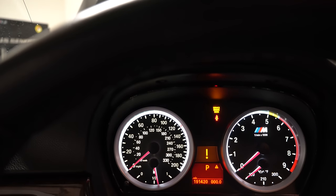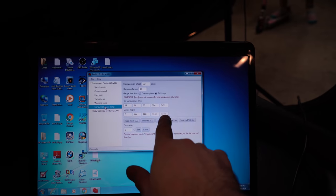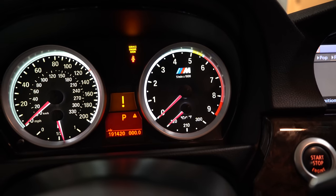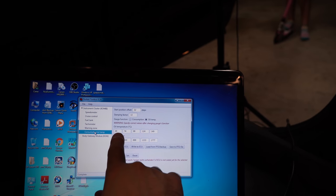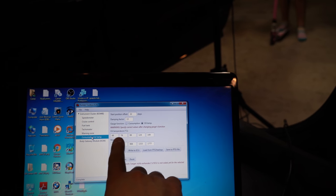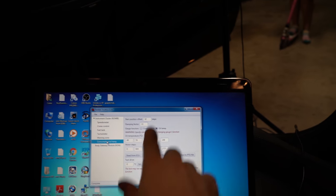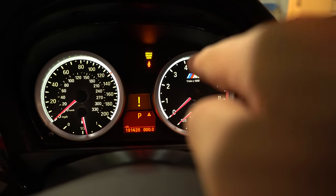And reset that - that's figured out. If we were to go to oil temperature - same story here. I divided this out proportionally. This gauge only reads from 120 to 300 instead of 160 to 340. So what I did was I converted that to Celsius and changed the range. It was 71 to 171, now it's 49 to 149. So you got increments of 25 across these four, and then you got the steps divided out equally. And since temperature is linear, that will be accurate. So my RPM is accurate, my temperature is accurate.